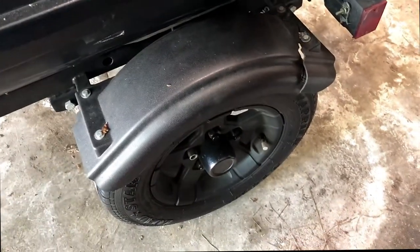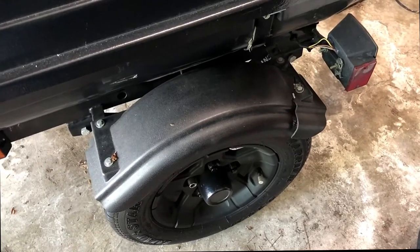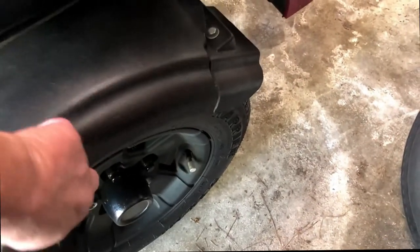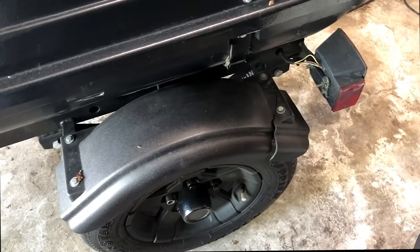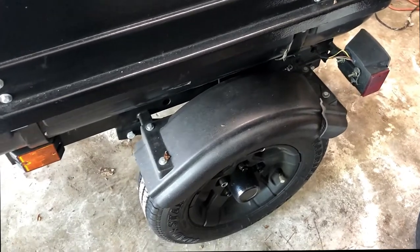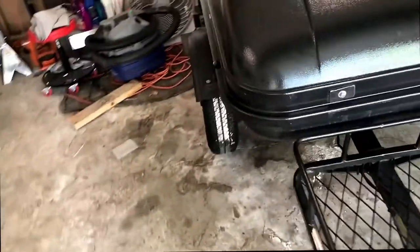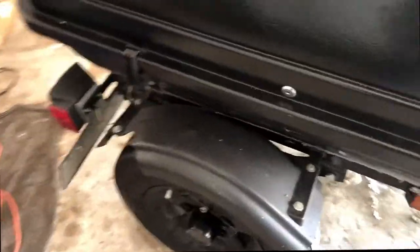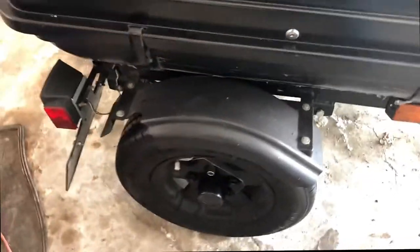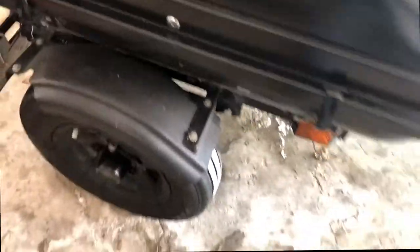Tire pressure on these wheels is about 65 PSI. The only issue was that these tires are slightly taller — I didn't realize that until I got on the road. They didn't start causing problems until California, which has rough roads with big bumps. This thing bounced around a lot. I didn't notice real trouble until I reached Oregon, where I realized the fenders were broken. You can replace them from Northern Tool — they're about $25 a side — and I'll space them out for a little more clearance.